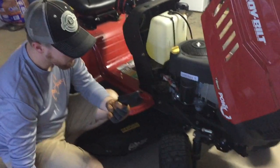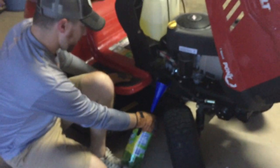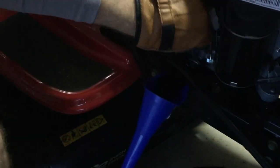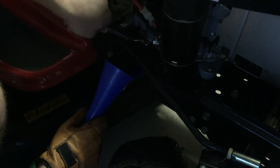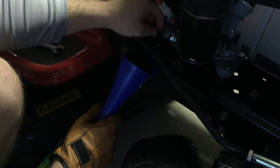Alright, so we've got our little drip pan here. We're going to place it underneath. We're going to take that bolt off — put the pan there first because it can get messy. When you get that bolt off, the oil is going to drain into your container. A funnel is recommended; it minimizes the spill. I'm using a half-inch wrench like I mentioned earlier. We're going to go counterclockwise — right to left as you're facing it — to get the bolt off. Righty tighty, lefty loosey.